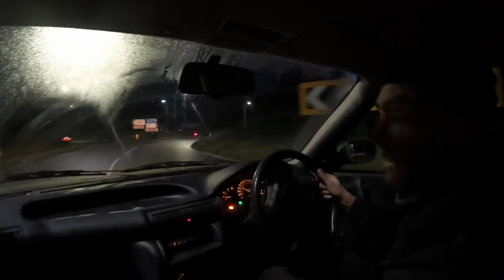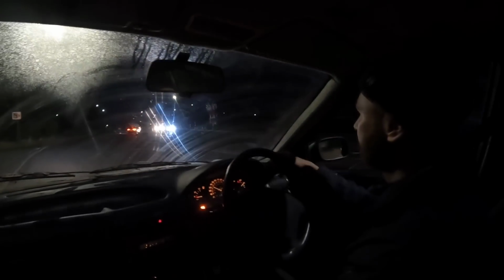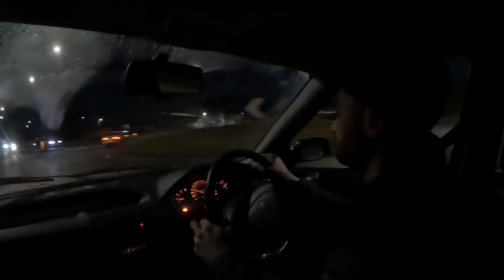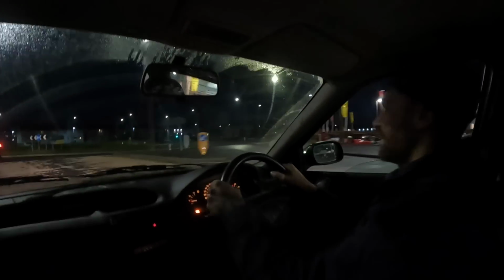See what that management light is. It can't be much, there's very little technology on these. It's 60 okay. Temp's just up over 90 with the heaters on full. Makes me suspect there might be a head gasket issue with this, especially with the way it ran on 3 cylinders. Hell was that? We're nearly there. Wouldn't surprise me if there's smoke coming out the back drums, because they are dragging like.